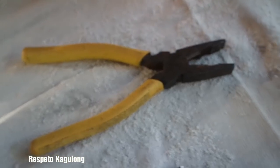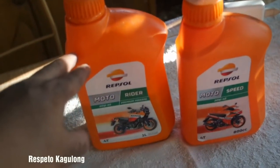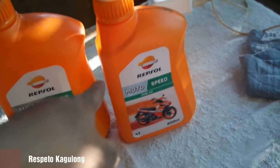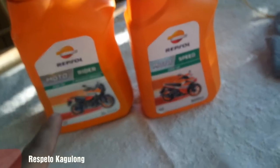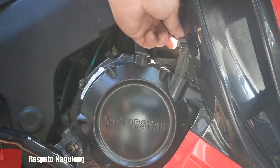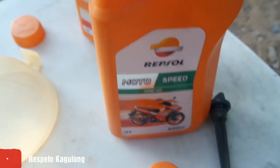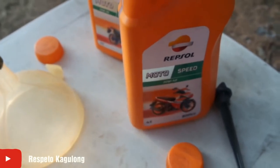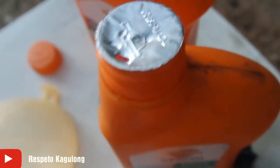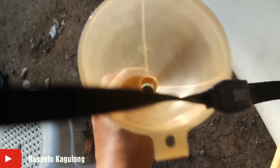When it comes to engine oil, as I mentioned, we need 1.2 liters. This is my old engine oil from my last change oil, and I just bought 800ml yesterday. I'll just add 400ml more to make exactly 1.2 liters, which is what our engine needs. The 800ml I bought didn't come with a straw like my 1-liter bottle. So I immediately got a funnel and attached a hose so I don't spill oil on the engine — it makes life easier.